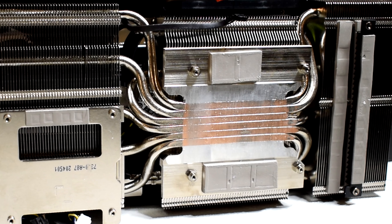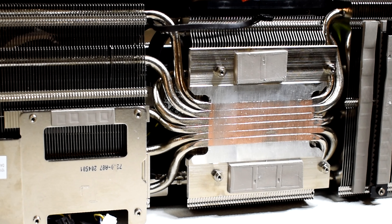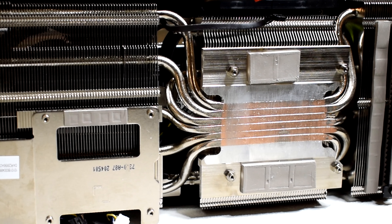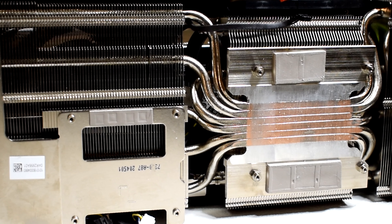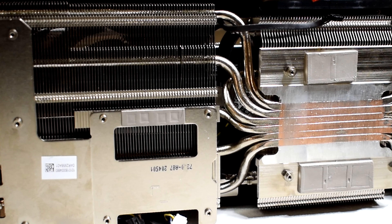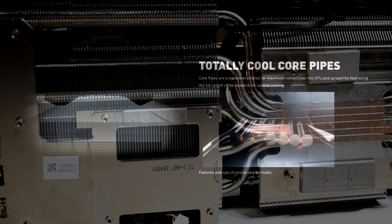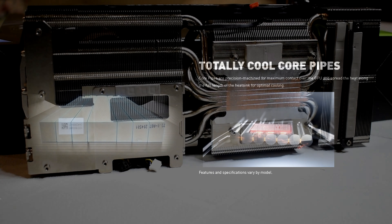You can also see the six nickel-plated copper heat pipes which run through the entire length of the graphics card, converged together making direct contact with the GPU. These six copper heat pipes are essentially doing most of the heavy lifting, taking heat away from the GPU core and then being cooled off by the air pushed from the fans. The RTX 3080 had seven copper heat pipes with a thicker one in the middle, as that GPU definitely needed the additional cooling. That's one of the changes MSI made for the 3060 Ti, but it's not problematic in any way.